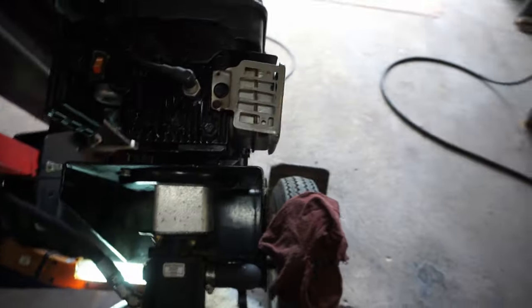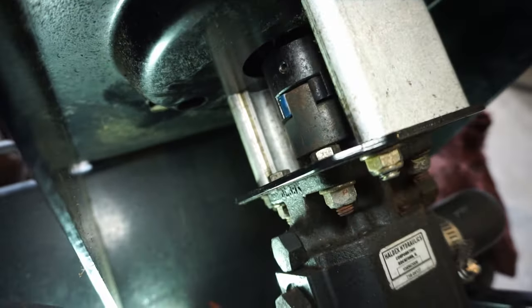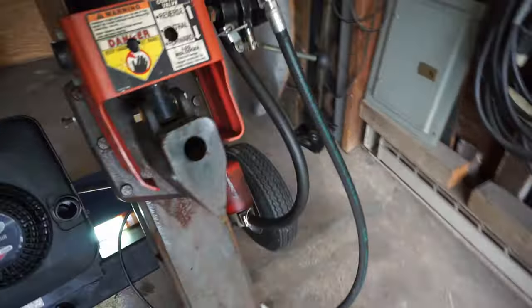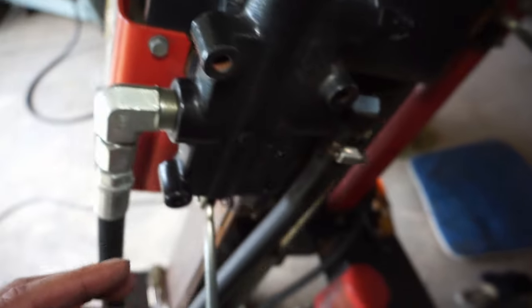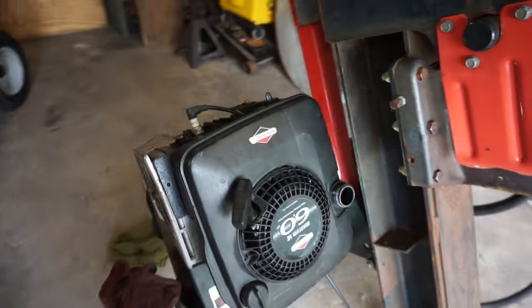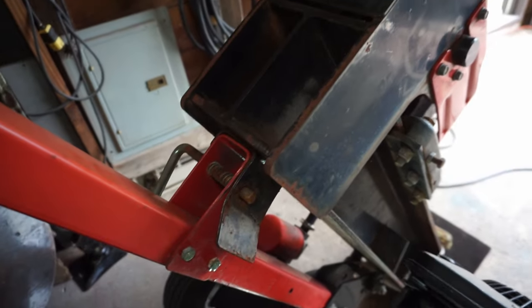It's on. I got the factory washers in because you need just a certain amount of clearance and it looks like it's right. I also tightened up on these hose clamps - he says he has some leaks. While I was tightening those hose clamps I can tell there's no thread sealant on anything. When I came over here to tighten this one, that's loose. We'll be looking at that later. Let's bring it down, get some fuel and oil in it and run it up.